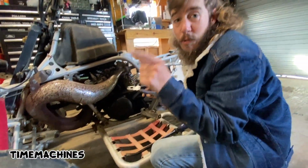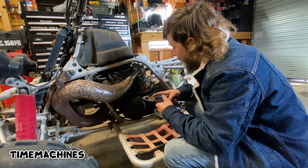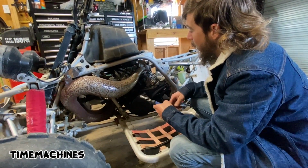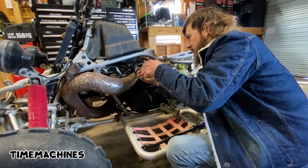I don't know if that switch worked, and it's full of gas, so I wanted to be able to put this back on here just in case. What it really was, he didn't want to roll it outside in the cold. No, now we'll roll it out in the cold and empty it. But I bet that petcock's clogged. We'll turn it on a little bit, because you would think there'd have been gas in that line with the switch on. Man, I can smell the funk.